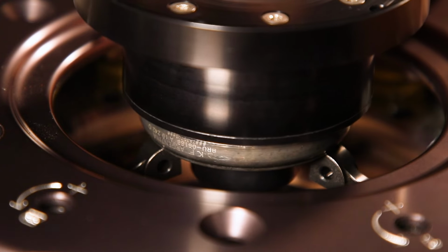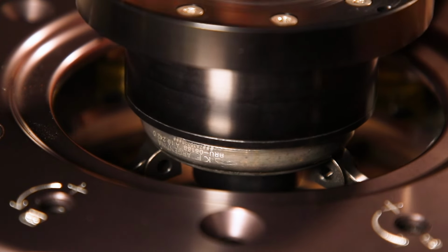The operation of this clutch is 100% reliant on the functionality of these levers. Therefore, you don't want anything interacting with these levers because it's going to take away from the functionality, change the functionality, or make it inconsistent. That being said, the main problem with using a hydraulic system on a slipper clutch is that that bearing is always trying to touch these levers. And what that can do, again, is create inconsistency in clutch tuning, and it can create some false info or data from the pass, depending on what happens with that release bearing during the pull.